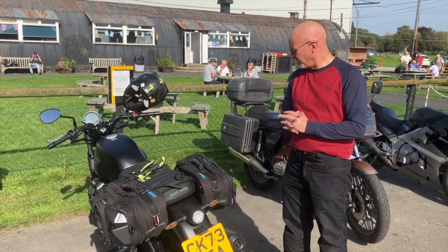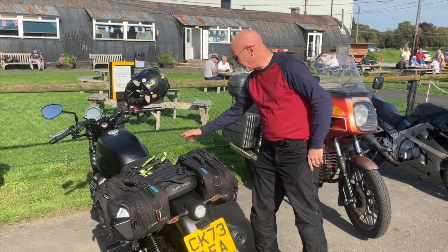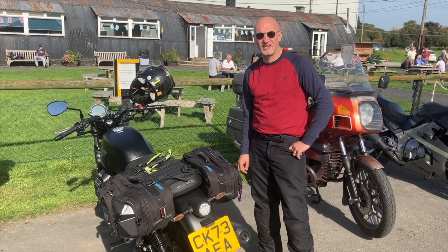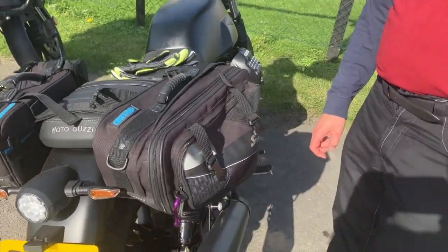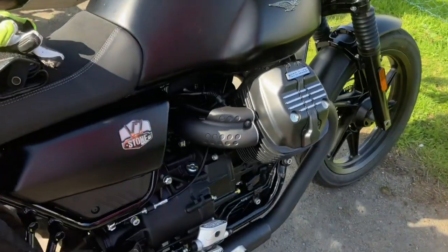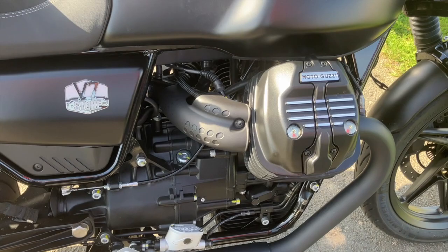The other reason I bought it is I like the ease of maintenance. It's air-cooled and it's got overhead valves with pushrods, so it's actually easy to do the valves. Compare that to a Japanese bike like my last Kawasaki - I had to undo nearly 40 fastenings just to get to the air filter. On this, it's four screws and take the seat off.